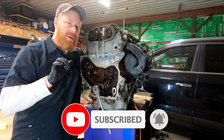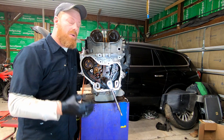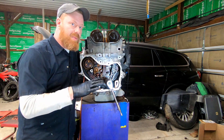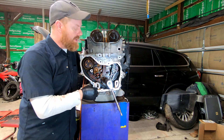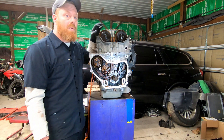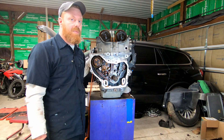Your car won't run. Sometimes it'll happen during startup, sometimes while you're driving on the road. Usually there are some warning signs — the DTCs in the engine computer. You may notice a rattle at startup. So that's what a timing chain does inside the motor. Now let's cover what happens when it stretches so far that you have interference with the piston to valve.